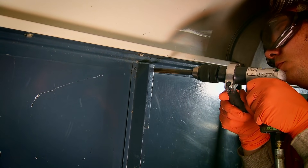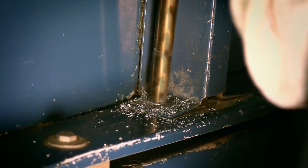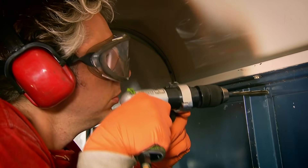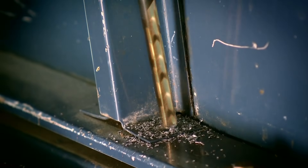To let the light into our Land Rover, I'm going to fit some big windows in the rear. But before I can cut any holes, I've got to remove these internal strengthening uprights. They're held in place with rivets that I'm drilling out with a high-speed steel bit.